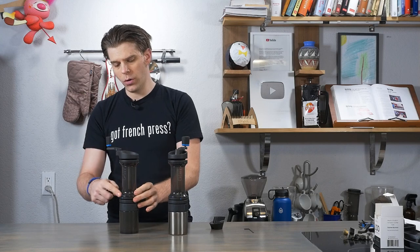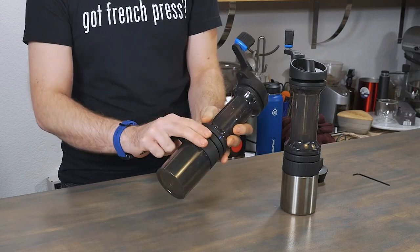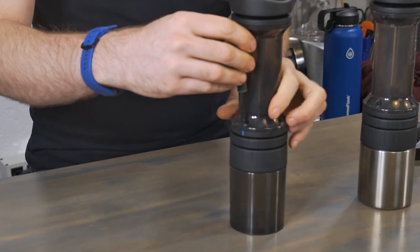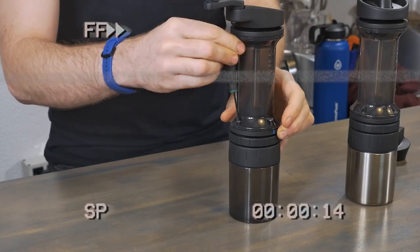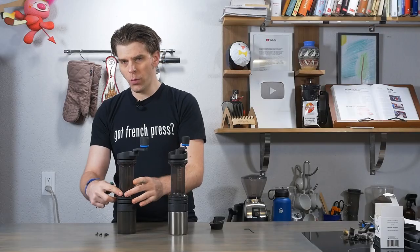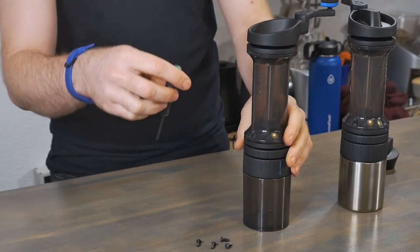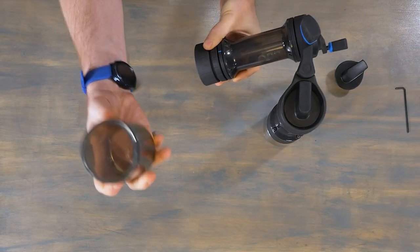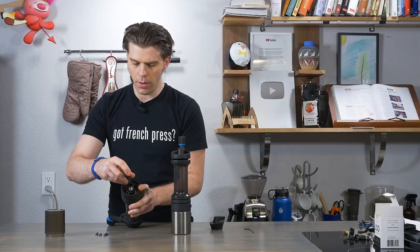What I'm going to do is loosen the four screws on the bottom of the Lido — just above the catch jar and the adjustment ring. After I've broken those loose with my right angle hex wrench, I'll loosen all of them to remove this part of the body. Now I've removed all four screws from the bottom. But before I can completely remove this bottom half, I need to first unscrew my catch jar, and then find this silver screw and washer and take that apart as well.